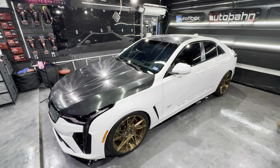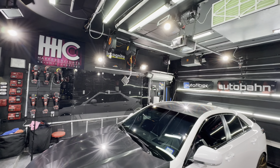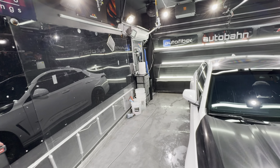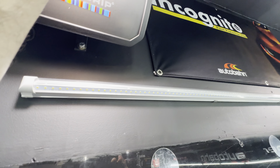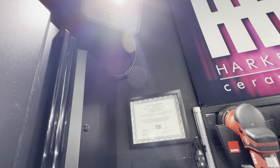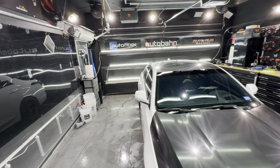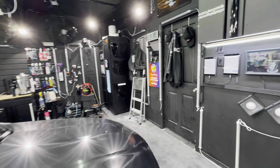This level isn't quite realistic for what a client would see in terms of defects in the PPF. So when I want to check that, I turn off the LED lights. Alexa, turn off the LED lights. Now we have all 11 scan grips plus the diffuse light. The diffuse light is more realistic. Scan grips alone are not diffused, so when we do coatings or want to see what a PPF job looks like to a client, we put large diffusers on — it makes the light more natural and shows you better what a job will look like in diffused versus focused lighting.